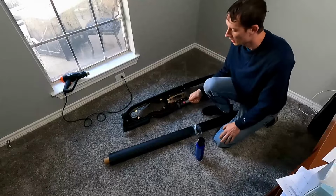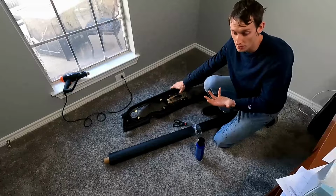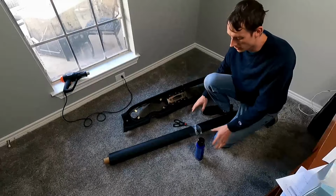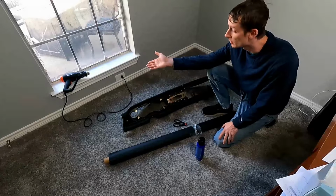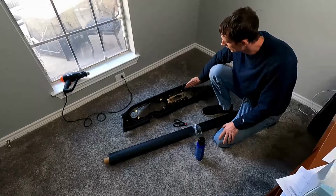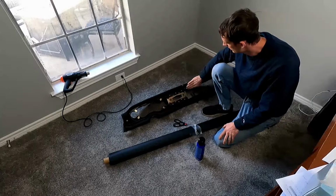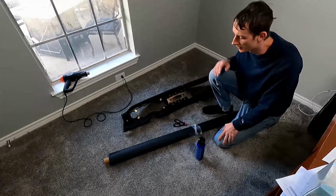It's heavy duty. Got ourselves some scissors, and we scuffed up the dash with some coarser grit sandpaper. That way the glue and the new material will really stick on there. We also brought in our heat gun with us. We're going to start on the top and slowly start working it forward into the crevice here and along the edge. We're going to try and do it all in one piece rather than sewing it.